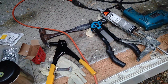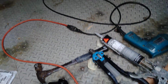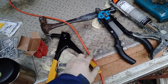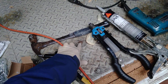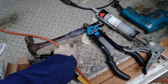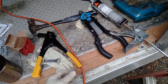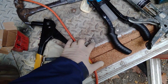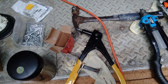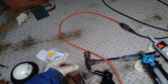I did try drilling some of these rivets out, and I was going to take them all out and replace them with aluminum rivets. But, oh man, they're so hard to drill out, and there's like 100 of them. I counted, it took me like 40 minutes to drill out a few rivets. It was really hard. So I replaced some; these are aluminum rivets. But solid rivets are good for strength.